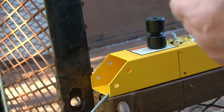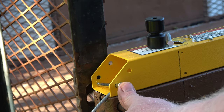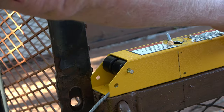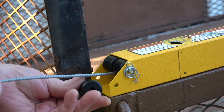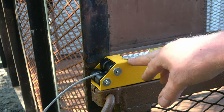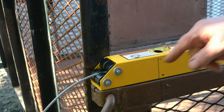Now we've got some rollers. The instructions say to go this way, but if I do that it will hit the gate, so I've got to go the other way — no question on that. Put the top roller in first, then a washer, put the cable in between, and install the bottom one. They have thick washers and thinner washers, and the center hole is a different diameter. Put two thick washers here, then the clips.